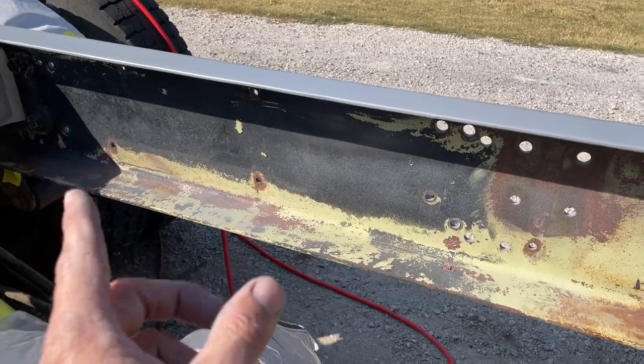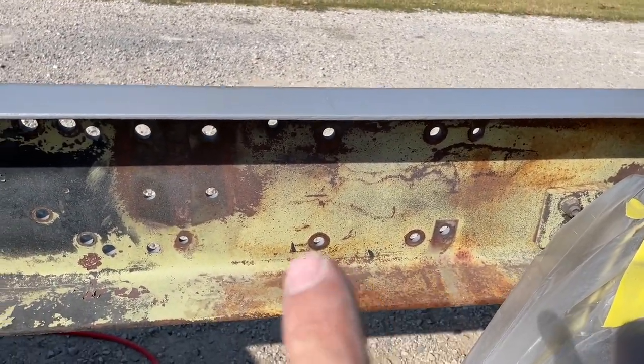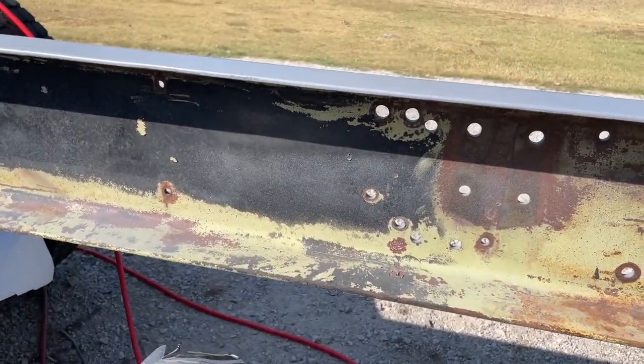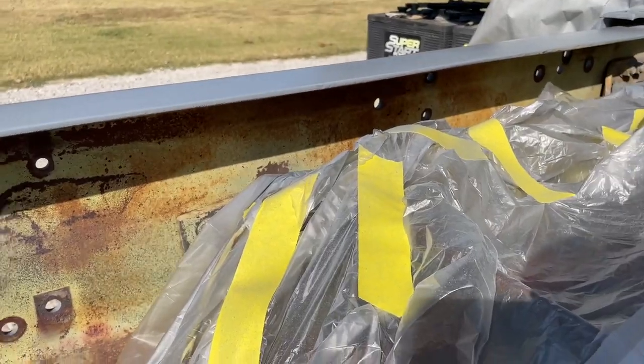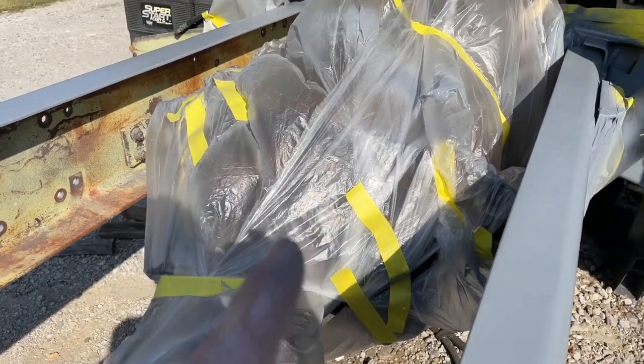That all there, there's very little of it that is down to metal. So there's not really much of a rust issue. It's more or less just a little light surface scale in a couple of spots, and I'll probably run the air sander where I can get to, shoot the epoxy on one side or both at the same time. I also have to do a real good degreasing on the bottom side, mainly of the transmission, clean any surface rust off.